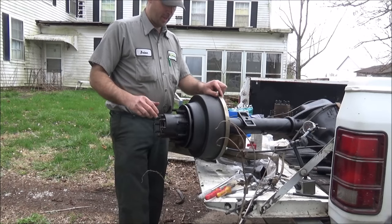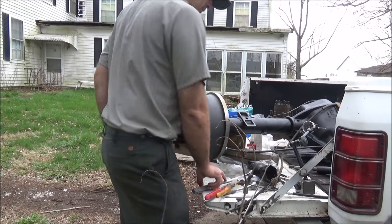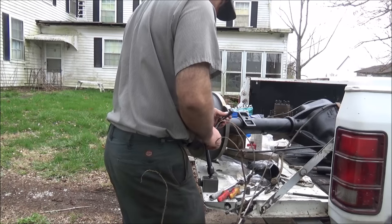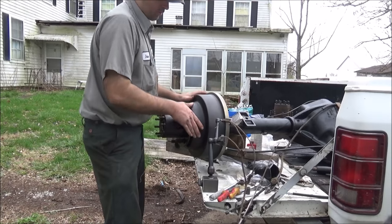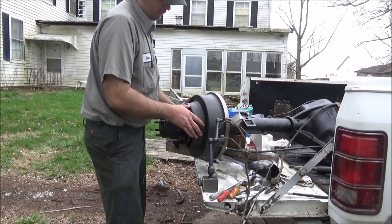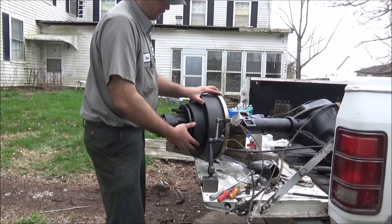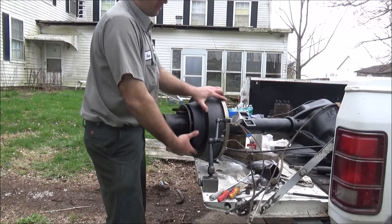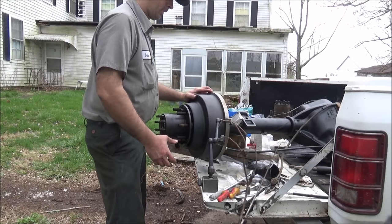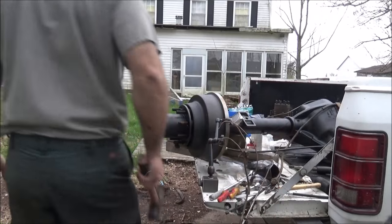The fact that it rolls and gets tight tells me that this drum's not centered. Let's see about this runout on this drum. Yep. Fifteen thousandths runout. That's high right there. Let's get a masher. When at first you don't succeed, get a bigger hammer.